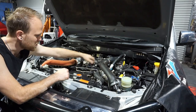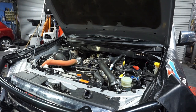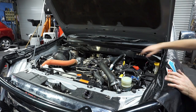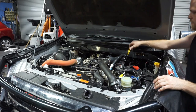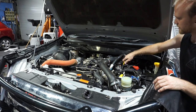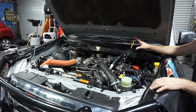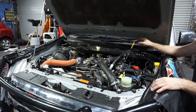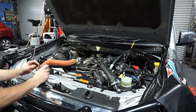I'll just pop this cap off and pull out the dipstick. I know that I'm going to drain the oil, and when I've got fresh oil in it I'll pop that back in so I know that I've got oil in the engine before I start it. It's just a nice little warning thing I like to do - you pretty much can't start the engine without the oil in there, because you've got this big yellow dipstick hanging out reminding you to put oil in it first.